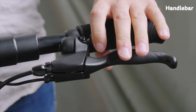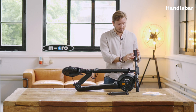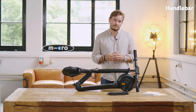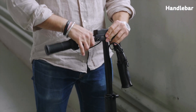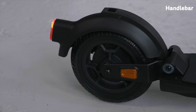On the left side of the scooter you have a hand brake with an integrated bell. Braking with this brake activates both the regenerative brake and the mechanical drum brake. Personally, under normal circumstances I really prefer using only the twist throttle as a brake because it's only regenerative braking — it's a little bit smoother. I use the normal hand brake if I really need to stop in a very short amount of time to maximize braking performance. Both handles can be folded down very easily — you just pull them out and fold them down. This is handy if you want to use it inside, put it under the seat of a train, or carry it in the trunk of a car.